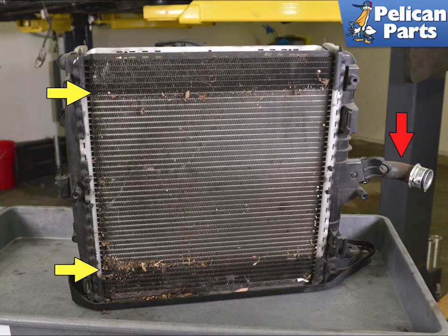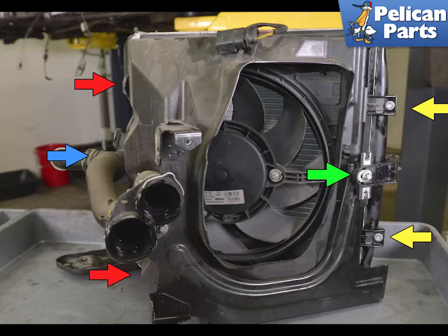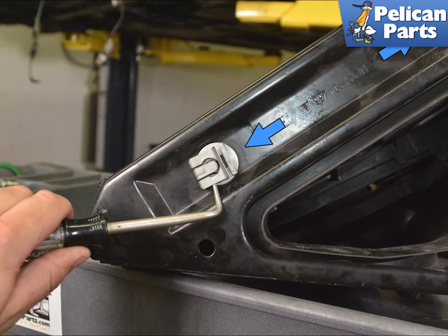This image gives you a good idea of what the radiators see in the form of wear, weather, and debris. Remove the E10 bolt and slide the mount off the shroud and radiator. Next, remove the two 10mm screws. Use your hose clamp pliers and remove the two hoses from the radiator. The radiator shroud has two clips on it — use your pick to slide the retaining clips off, and then you can remove the radiator from the rubber mounts.